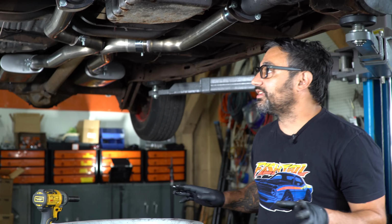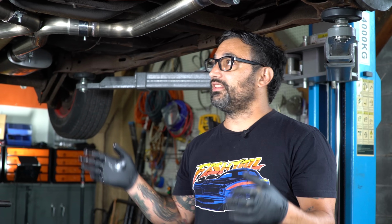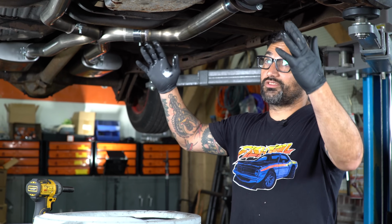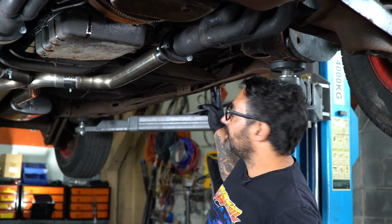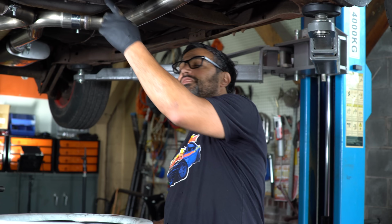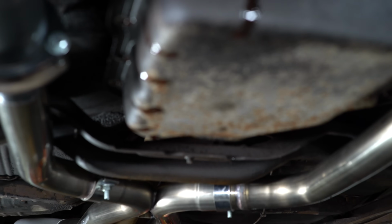All right, so one cool thing I learned from having this car is that if you swap a 200 4R in place of a turbo 350, the short one, which would have come in this car, you can use your stock drive shaft because the whole transmission is exactly the same length. The mount sits back about 7 inches, but on a full frame car like this, all you do is move it back, find 2 new holes, and bolt it in. So you got your stock cross member, stock drive shaft. It's like a very straightforward swap. Get that extra gear.